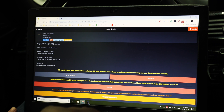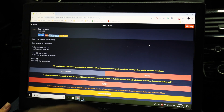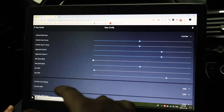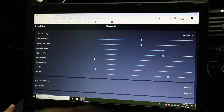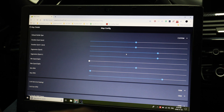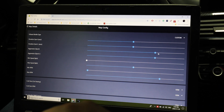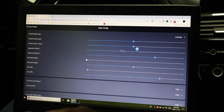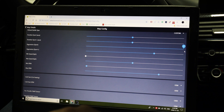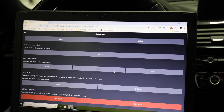Now onto the fun stuff — let's make some burbles happen. Hopping back onto our laptop, under the 'Your Maps' menu every map is also configurable by clicking the top right button. Here you can set your exhaust burble aggression and duration for the different modes of your car. You can even set the minimum speed and RPM that it will activate, so it won't sound overly excessive when you're just looking for a parking spot or picking up your kid from school.